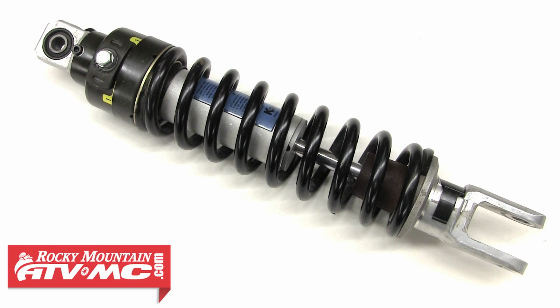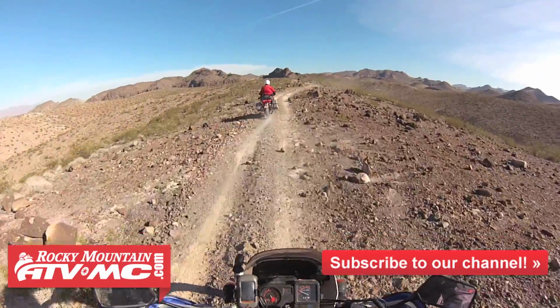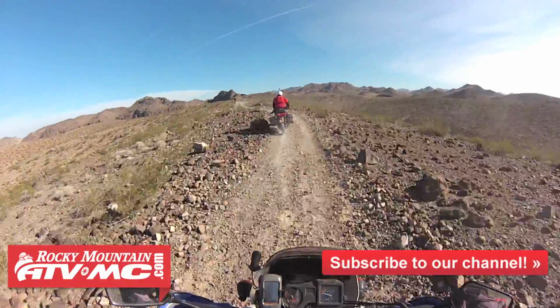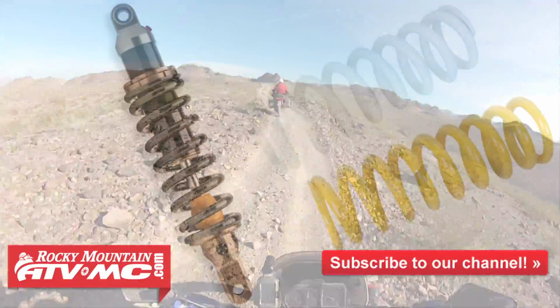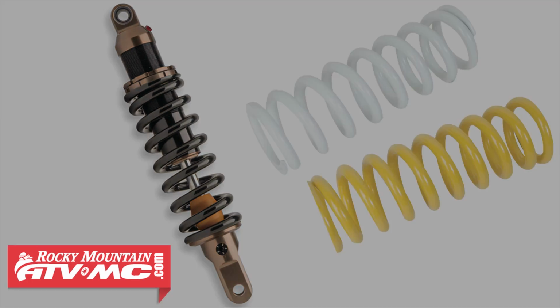For most adventure riders, the stock KLR shock spring is too soft. If you're a heavier rider or plan on running panniers or additional gear and luggage, a heavier spring is highly recommended. Rocky Mountain ATV MC offers a variety of different spring options to suit your needs.